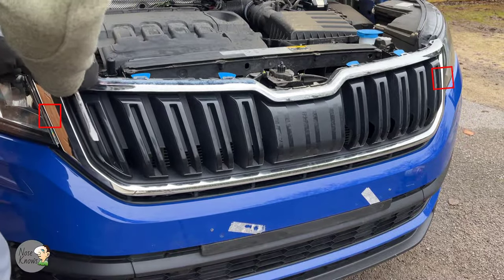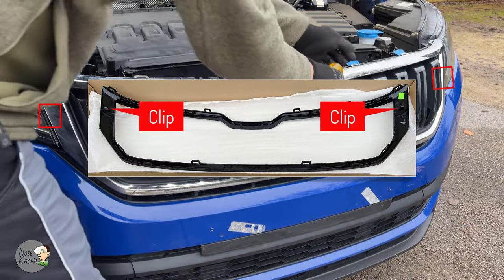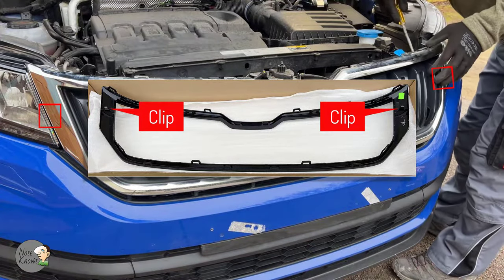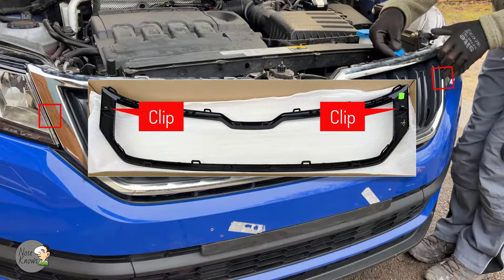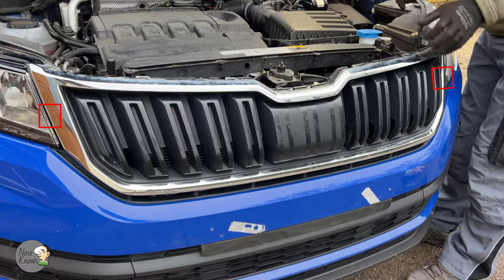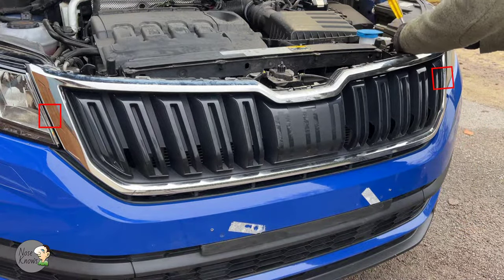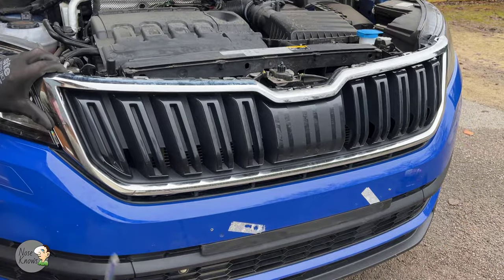The next two clips to tackle are on the left and right-hand center, sitting at about the middle of the surround as indicated with the red boxes. The trick with them is to put your screwdriver in on the underside of the clip, pull it up away from the floor, and then whilst doing that pull the surround toward you. I try with my fingers first but it won't come, so I put the screwdriver back in, just lifting the clip slightly so I can see it's clearing the hole, then pulling the silver chrome toward myself - it just releases from the slot.